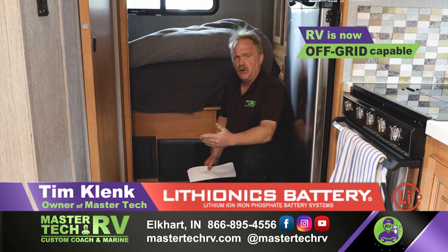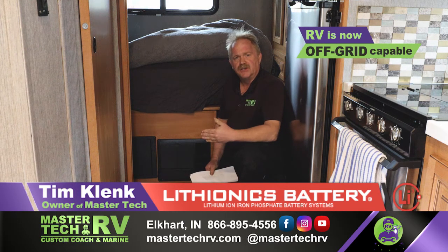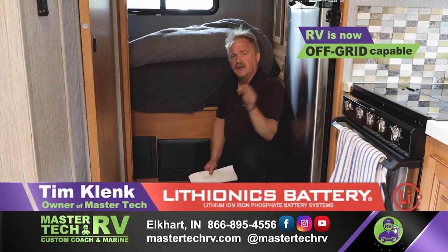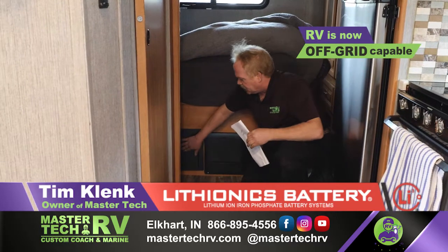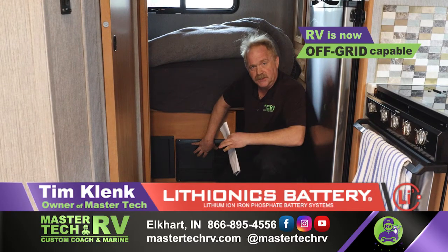In traditional installations like boats, they typically put breakers you turn on and off to prevent overloading the inverter. But in an RV you don't have a command center for that, and circuit breakers on these systems are not made to be switched — they're an overload device, not a switch. Items like the water heater with a 110-volt element you would never want to run off the inverter. You want to save the inverter for the refrigerator, air conditioner, TV, microwave, and other 110-volt devices. So we have a separate distribution panel here specifically for all inverter devices, and we moved non-inverter items out of the main panel over to that separate panel.